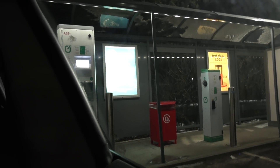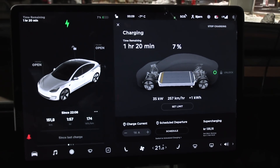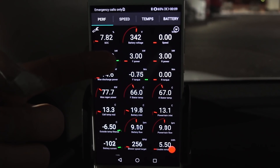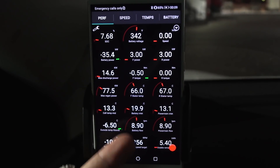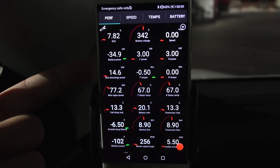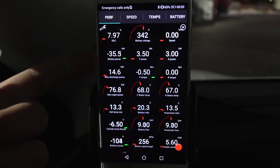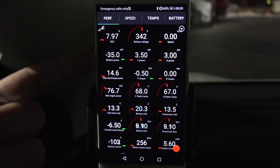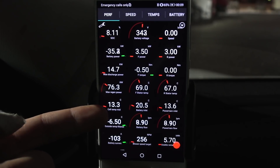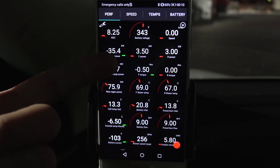We are now at the Grungotak charger, the same one we charged at with the Performance, and we came here with 5%. I just want to make sure we can make it back to Oslo. What you see here — I call it the afterburners — the motors are running, pulling six kilowatt combined to heat up the battery. The battery inlet temperature is rising. But we only need to charge for five minutes, so we don't really care about heating the battery. At a high power charger we'd get 150 kilowatt anyway. Because this car has heat scavenging, it's no big deal — once we start driving, it will scavenge heat from the battery and consumption will be ultra low. But with the old car without a heat pump, this is basically a waste of energy.